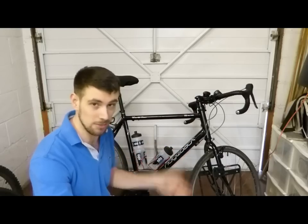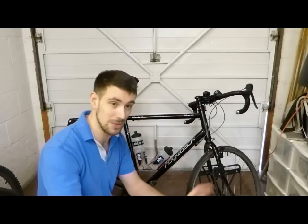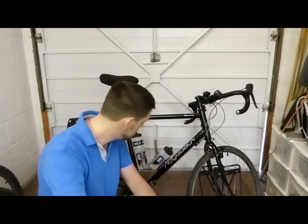You're going to be carrying all that weight and you want the lowest gear possible so you can keep going up. You don't want to ever get off your bike and walk. It's never a good thing. So getting something with a really wide range allows you to have that availability on those steep hills, but also keep high gears available for when you're trying to put out some serious speed.